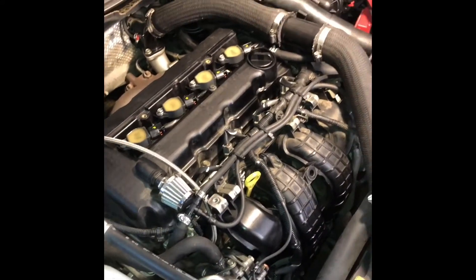Now for the water lines: you've got one water line right here that goes into the throttle body, and another that goes into the thermostat housing area, directly underneath this big hose. Water comes out of here, runs through the turbo, comes back out, and then goes through that hose back into the engine — the one on the thermostat housing directly underneath this hose.